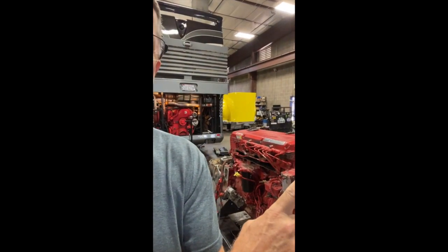So you have to understand that when they do these placarding, they're looking at flywheel numbers. You know, it could be an engine on a rack in a dyno room like that. And that's not what we're after. We're actually after what's on the ground. So their dyno is on a roller and that measures the ground horsepower and ground torque. And then the software on the computer will extrapolate those numbers and give you what's calculated based on the final drive ratio into a flywheel number. It most likely will not match the well-known 600 posted horsepower of the ISX motor.